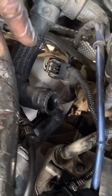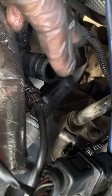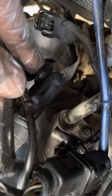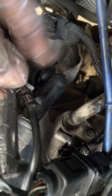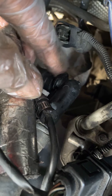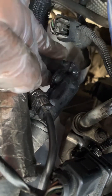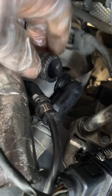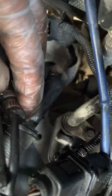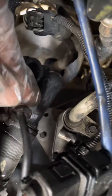I decided to follow where the leak was going, and lo and behold, I looked behind here and noticed this hose right here, which they call the heater hose T. I noticed this was broken off from this part right here. From my research, apparently most Ford vehicles usually have problems with this breaking off — it seems to be a defect. I could see it was leaking and wet, and I knew this part was broken off, so that let me know exactly what was going on.